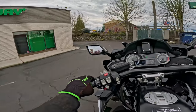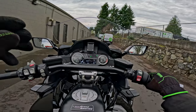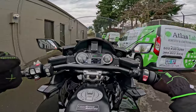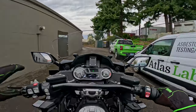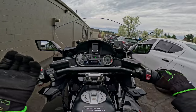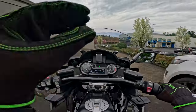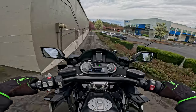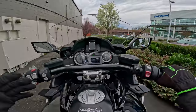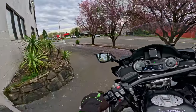These things — if you don't use the shift assist pro, they just clank. Harleys clank because of how the detent works — when that thing falls into gear the hand of god couldn't knock it back out. You don't get false neutrals; that clank is the shift coming to a very solid, precise stop. It's crazy. I'm assuming something similar is going on here because that's kind of what it sounds like, but I've gotten false neutrals out of these things.